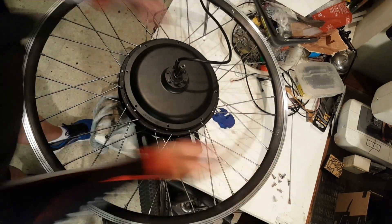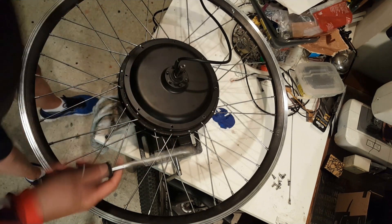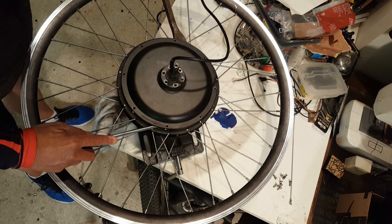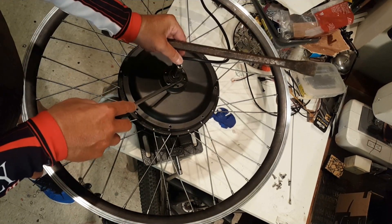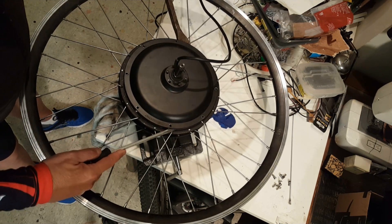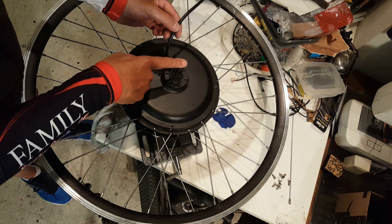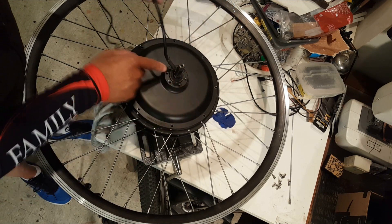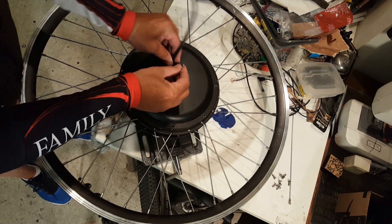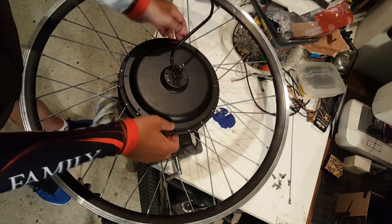I've also pried this up a little bit in advance so that it's clean. This was done with a screwdriver on one side and a crowbar on the other, just slightly wedging up both sides. What we're trying to do is get over this hub here. Once you get it to a certain point — it's about an eighth of an inch free now — I'm going to come in with a rubber mallet and start pounding on the axle. The vibration of the mallet will push this out and this will pop off.